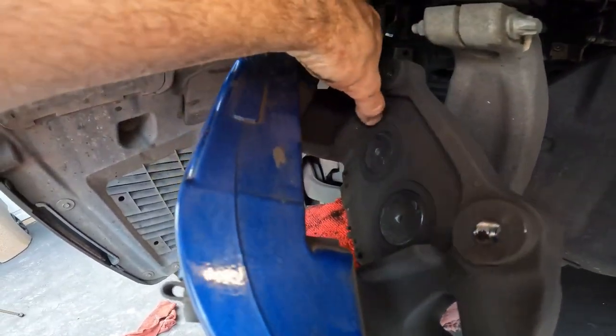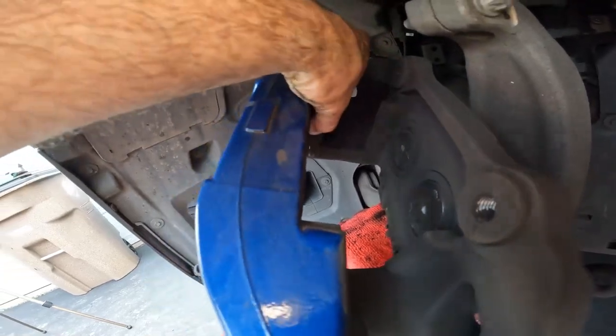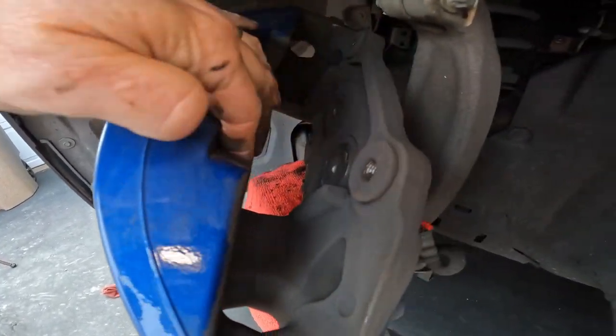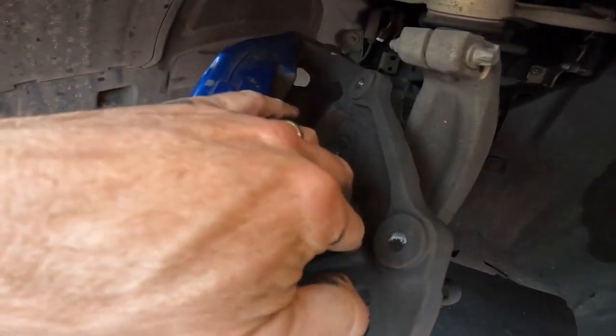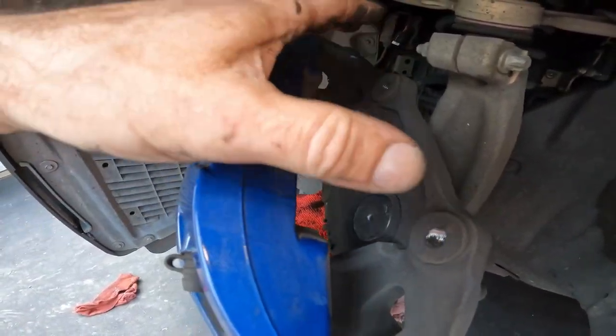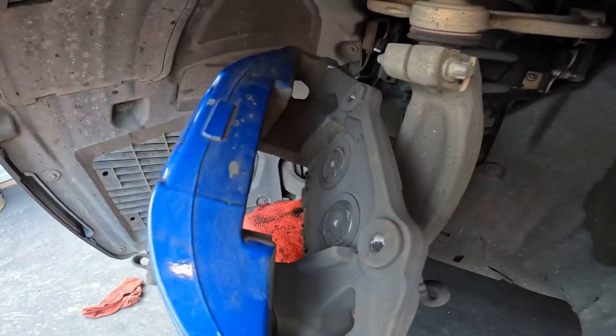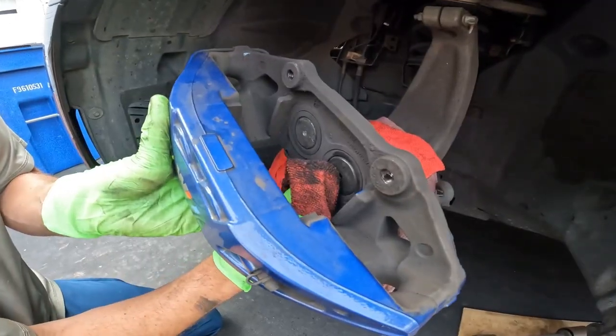And right here, this surface here and this surface here, and on the opposite side here and here, is all unpainted surfaces, and that's where the pad sits. So you're going to want to clean that with some Scotch-Brite. We're going to go ahead and clean that up, and then I'll show you what it looks like when we're done. Spray a little bit of brake cleaner